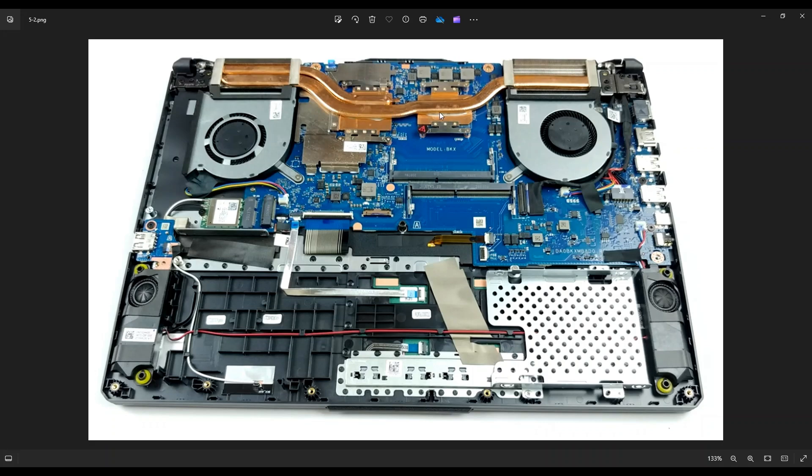If you're here to access your heat sink and your CPU to reapply thermal paste, there'll be a video link above and also below in the description — it's a quick tutorial on how to reapply thermal paste correctly. You want to clean all the old stuff off, get it nice and clean, and then not reapply too much thermal paste.